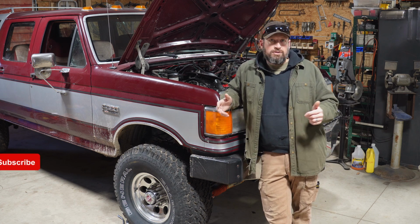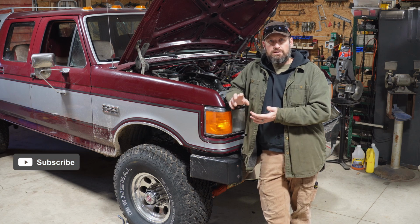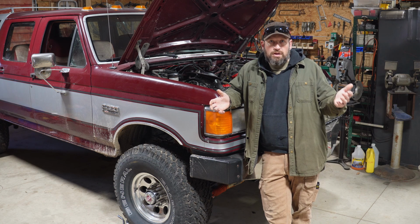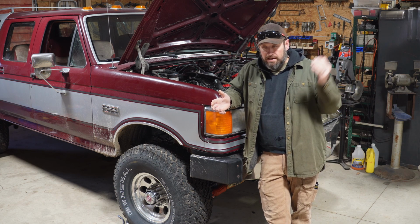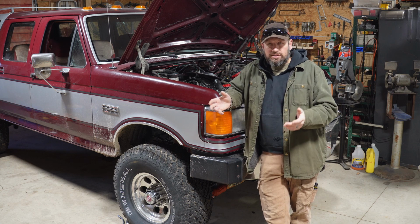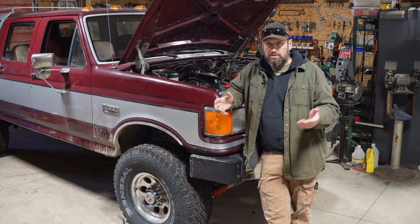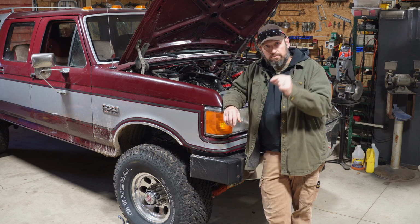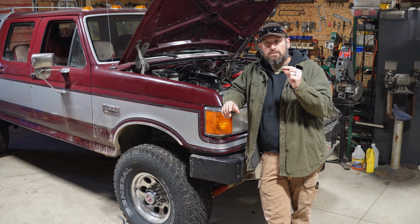So the next steps: I've already drained the oil and checked it. It doesn't look bad. Really no metal particles. I drained every last little bit. I let it drain for probably 15 minutes. And then I not really screened it, but I put it through with the magnet, and I wasn't able to find any real metal. I did turn the engine over and check the push rod up and down.